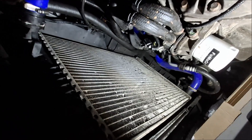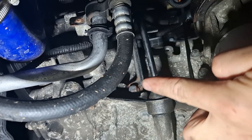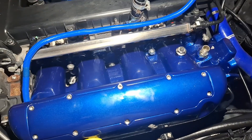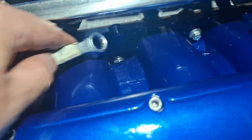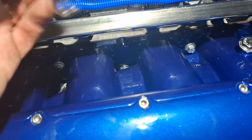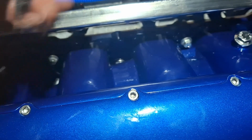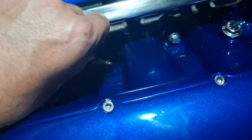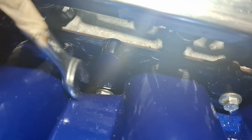So now with the radiator fan out of the way we can move on to the dipstick - there's just a single bolt securing this onto the bottom and now it's death by a thousand cuts. I'm having to use every trick in the book: a little bit of the ring spanner, a bit of the open spanner, flip that over to the other side, all to get about 10 or 15 degrees rotation out of this bolt. You'll probably spend a good 10 minutes getting this one out.